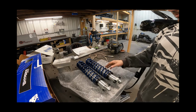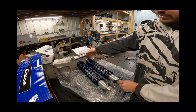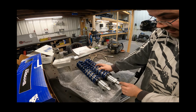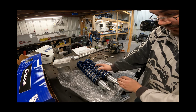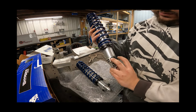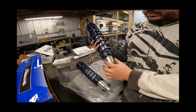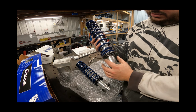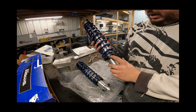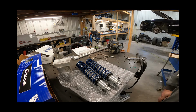So that's how you put those on there. Sometimes they are a bear, because if you have a shock that's basically minimum extended length for like a 12-inch long spring, it's a real pain in the butt. I have taken the Allen out of this before. Now, strange if you're listening, I'm sorry that I did this, but I have taken the Allen out of this compression adjuster, and I've taken this rebound Allen screws out. I never had any bad luck, but that would allow you to get this lock collar off and then get this first nut threaded down even further, to give you quarter inch or so more out of this. So if you're having any troubles with that, just an idea. Don't take my advice because I don't know what I'm doing.